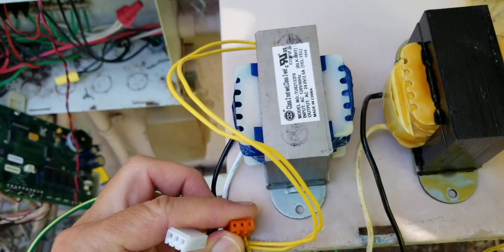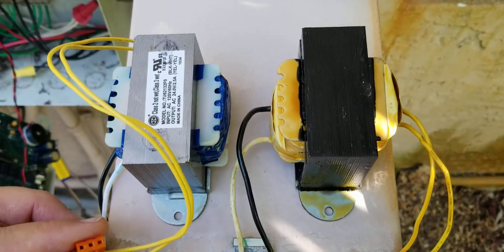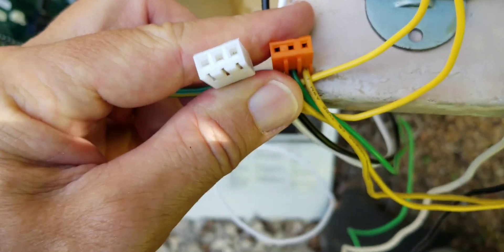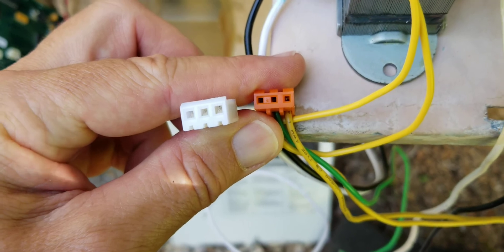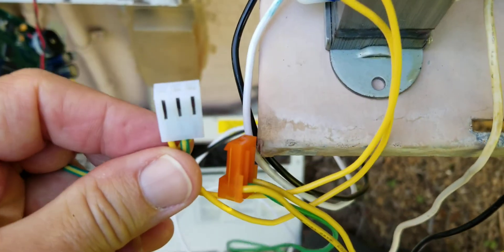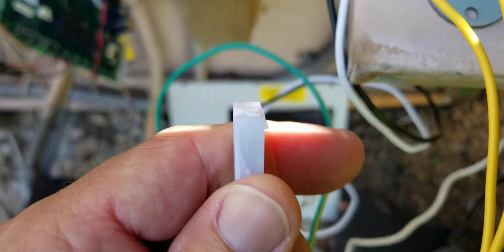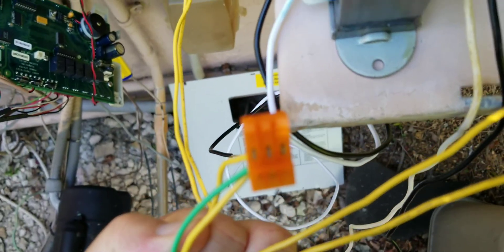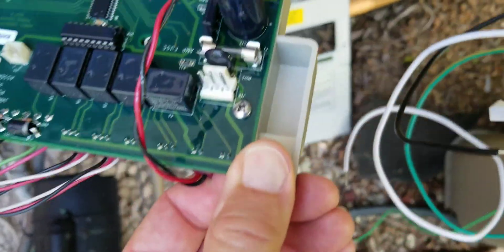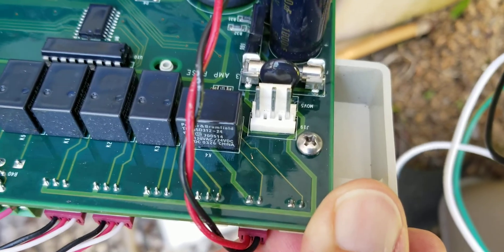The new transformer seems very similar, but this part here is different. The one on the right is the old one that was in the unit, and the one I received is on the left — the one with the white tip. It looks like it will fit, but in the back there are two grooves that the old one has and the new white one doesn't. Looking at it, that's not going to be a problem since the back has nothing to do with the mounting.